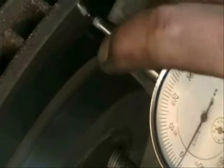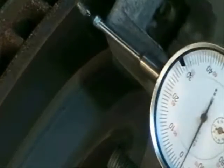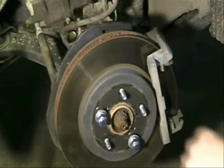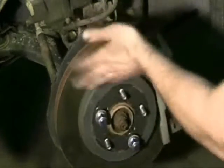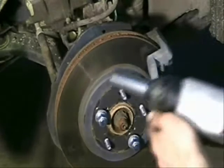Now I'm going to relocate the gauge to another area to get an average of readings and test the run-out there. If that run-out spec is also really low and about the same, then if there was a brake pedal pulsation problem, I could rule out at least this rotor. I'd have to check the other rotor as well, but then I might think there's some front-end component issue — it would really help me to rule out brakes. So now I'm done with my run-out measurement. The customer did insist that I resurface these, so we're going to go ahead and do that.